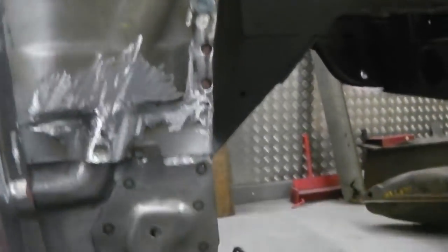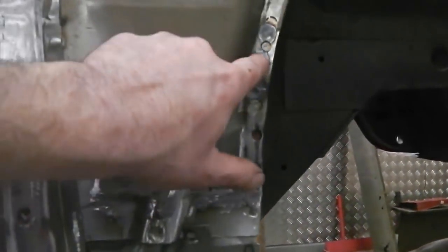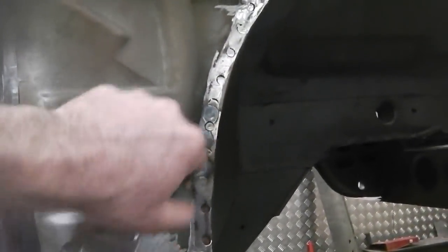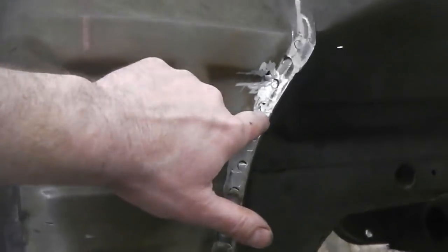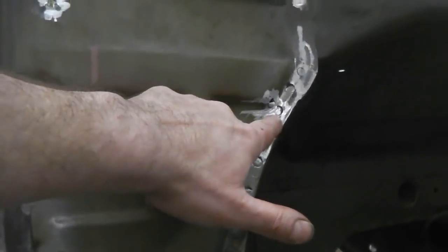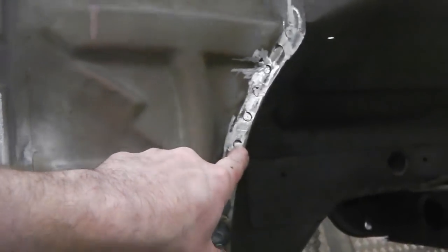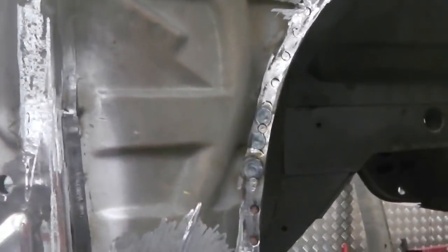And the way that the welder's set at the moment is set for the large size dimples, which these are. So we go in between the plugs, right? Some of them plugs, look, that one's made it, they've all made it, but some of them don't complete the full circle. So I'll have to watch that when I'm swirling around, if not quite hit the edge. I mean, they're all equivalent to what a spot weld would be, because it's touching at least the same contact surface area that a spot weld would have, but it'd be nice to just get improved on them